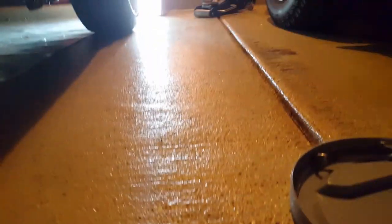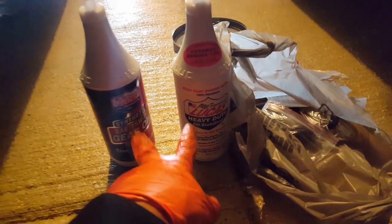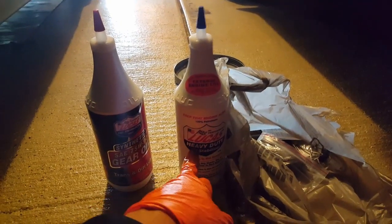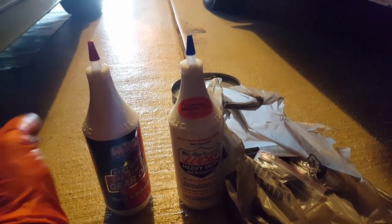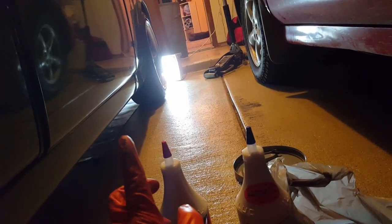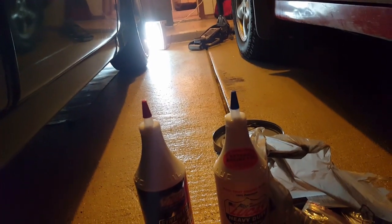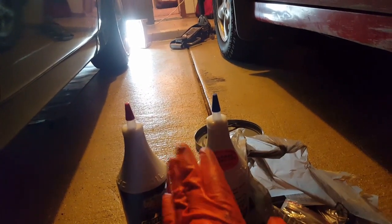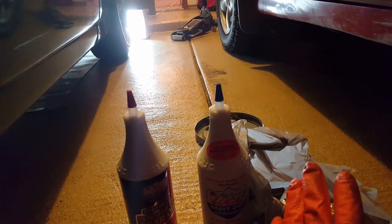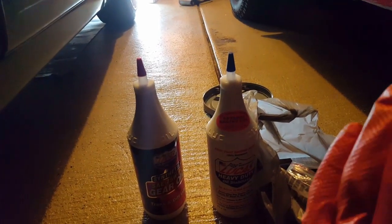You can see under here a couple of spots where it's leaking. I kept down that plastic to keep my brand new shiny floor new and shiny. This transmission — the M40, along with the M47 — takes 0.8 quarts. So I'm going to use 0.4 and 0.4 of these guys. I'm going to pour it in through the shifter since I don't have jack stands and I can't get the car to fit on ramps. Once I move all that stuff from the old garage, we'll be fully equipped — but first I need shelves, but first I have to do a transmission change.